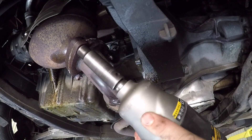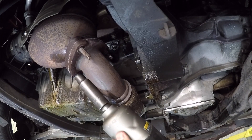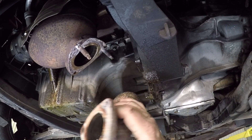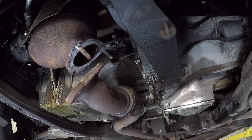The exhaust pipe is connected to the bottom of the catalytic converter. This one has one bolt and two nuts. These are typically quite badly rusted, but in my case I was pretty lucky and it came away fairly easily. You just want to pull the exhaust out of the way — there's a little metal gasket in there, don't forget about that.